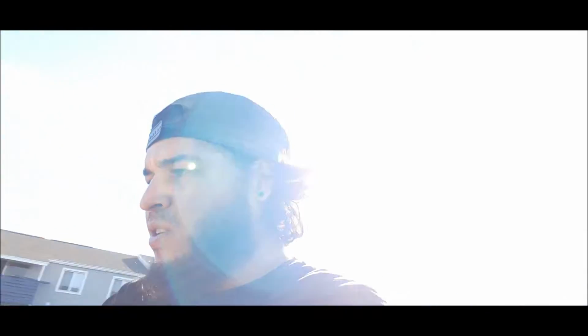Alright, so as you guys saw, I went ahead and did this little quarter section here. I'm gonna do sections at a time so we don't get too ahead of ourselves. So everything, I just sanded down. I went ahead and wiped it and everything. So now what we'll do is go ahead and just prime this area here and then move on to another section and just keep going like that. So we'll do this quarter and we'll probably move on to like the roof or something, the door, and then the other side, since the fenders and stuff are already done.